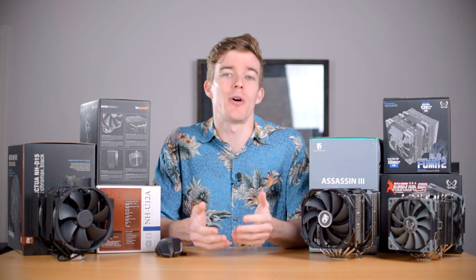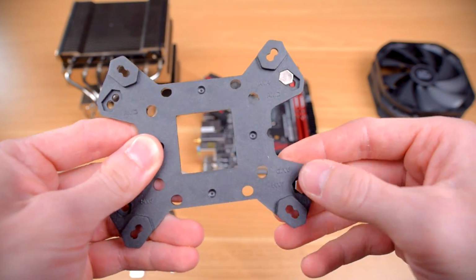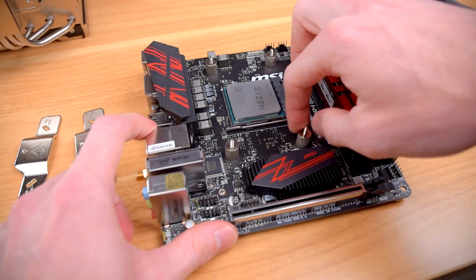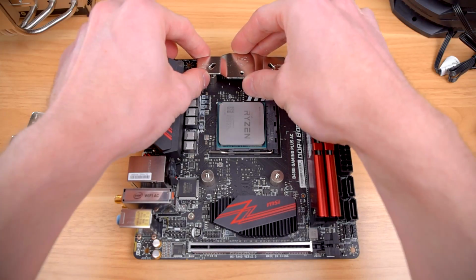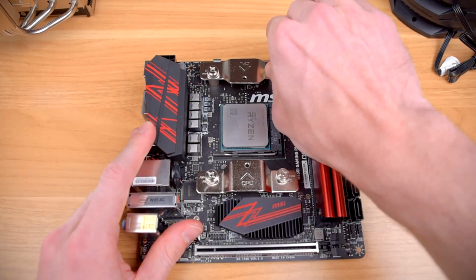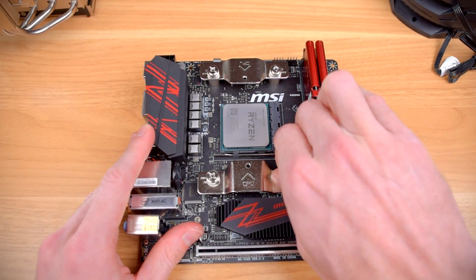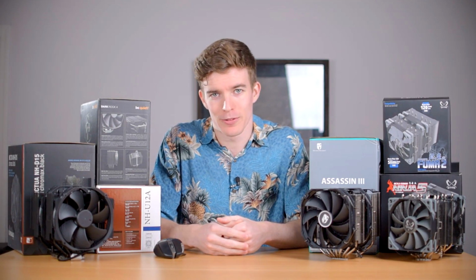However, it uses its own backplate rather than the stock backplate, which adds hassle because you need to attach screws to the backplate in the correct holes before putting them through the motherboard. And then on top, it uses threaded spacers to first hold the backplate to the motherboard, then the support bars go on, then another set of threaded nuts goes on top to hold those in place. All in all, it is slightly better, but it still leaves a lot of room for improvement.